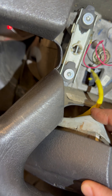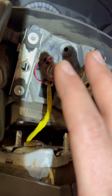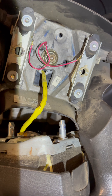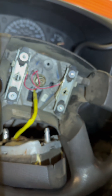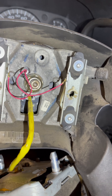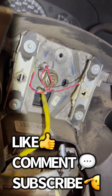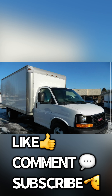So we're going to get some Torx bits and pull them off and clean them up and hope that fixes it. You guys want to be very careful with the airbag — just kind of move it out of the way. Feel more comfortable taking the battery cables off? Definitely do that. So I'm going to show you where a lot of the problems happen with these. Most of the time it's these pads — there's copper connections behind them that get dirty. So you want to clean up behind those pads. And another spot is this one right here.